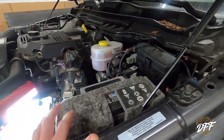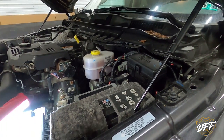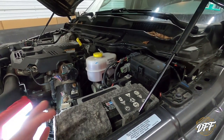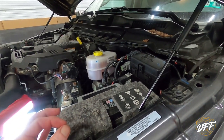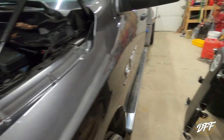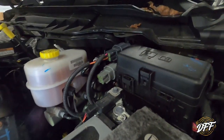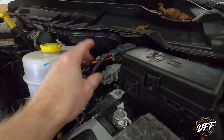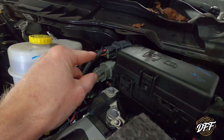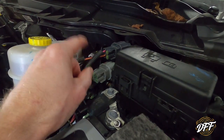Slight change of plans. It's the next day after the previous clip in this video, and I decided I did not want the camera on all the time. I was thinking the 12-volt line I had connected to would shut off when the truck was off, but it does not — it has 12-volt power to that trailer plug 24 hours a day, which means the camera would be on 24 hours a day. So what I did was run a wire from the front to the back. RAM has these upfitter switches in the cab and you connect to them here. There are two little ports — the first one was for my lights, which you've seen me install already. The second one I just added is switch number two, and that will turn the camera off and on.